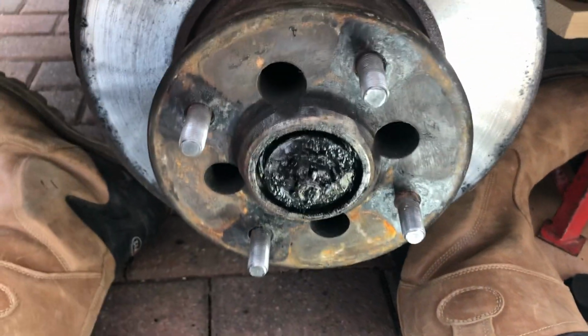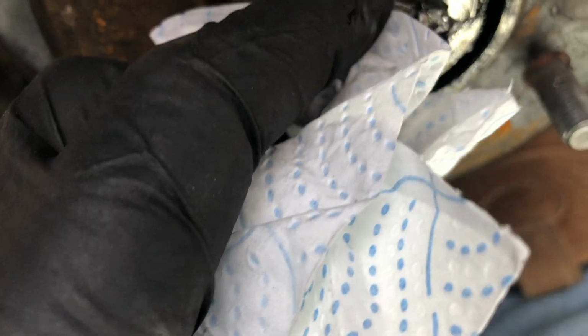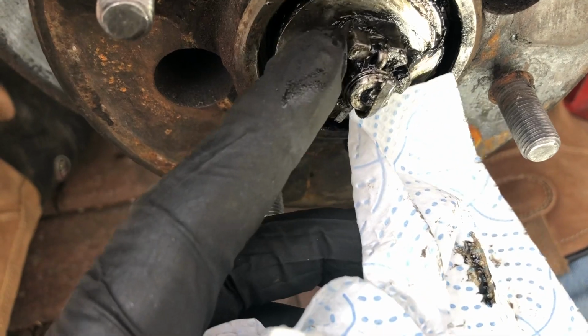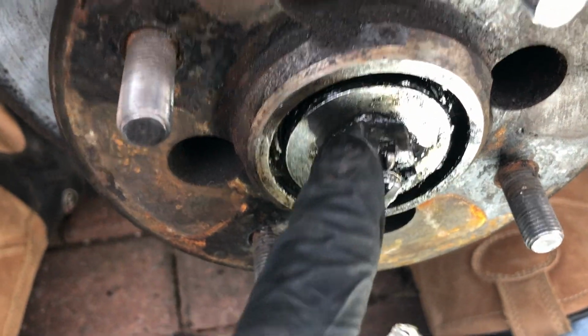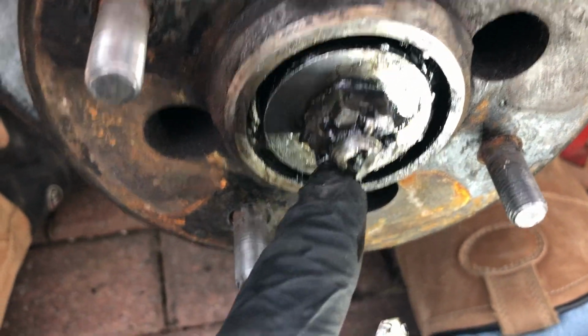Okay, so let's clean off some of this grease now. Which I will replace. These castellated nuts are done up to 5 pound-foot torque and then backed off by just one slot, such that it allows the hub to have some end float, meaning it can move around a little bit. You don't want to over tighten them, obviously. Tighten that nut too tight and then you won't be able to turn the wheel, and you'll mince the bearings and that won't be good.